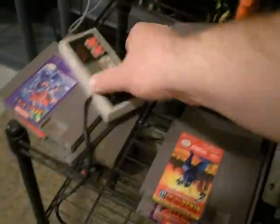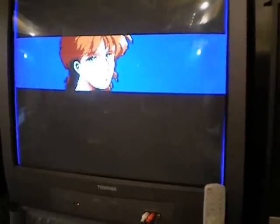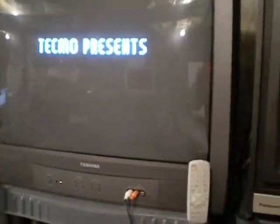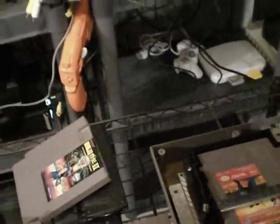If I really want to play an NES these days, the only way to do it is either to buy a top loader or make them into some kind of top loader. There are some games that will work in this — I've cleaned every one of these games with an eraser, so that's a pretty intensive cleaning. It all comes down to what pins the cartridge uses and whether those pins are clean or making good contact. You can play Ninja Gaiden 3, but you can't play Ninja Gaiden 2, which is sad because 2 is much better than 3.